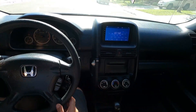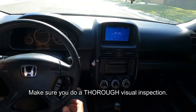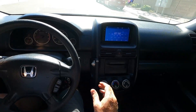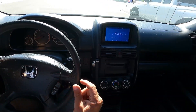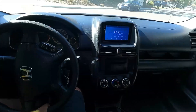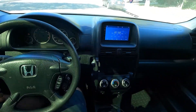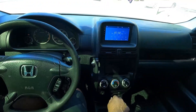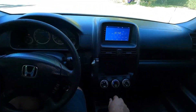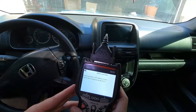You do need to do a visual inspection before you go throw new parts at this. We're going to pull off the wheel and see if we can take a look at the wheel speed sensor — sometimes they get real rusty and swell, which ruins the gap so the sensor won't work. We're not getting the ABS shaking and activating like the owner said, so that may be happening intermittently, but definitely with no signal from the left rear wheel speed sensor we're bound to have some sort of an issue.